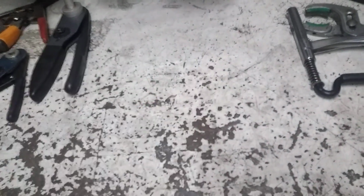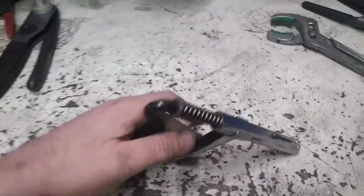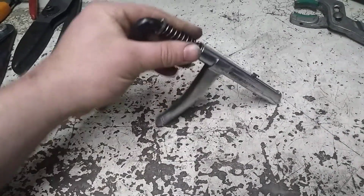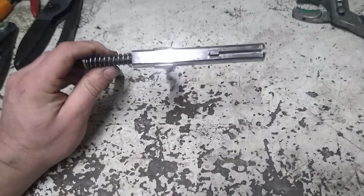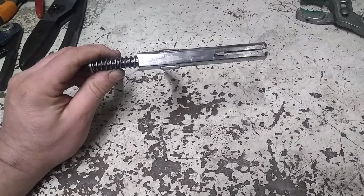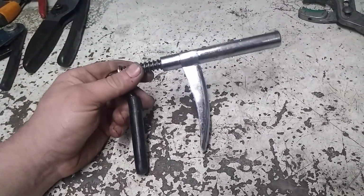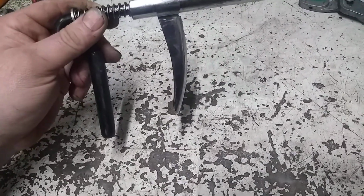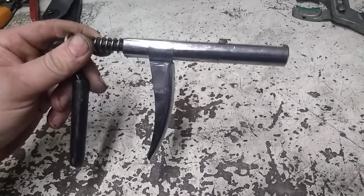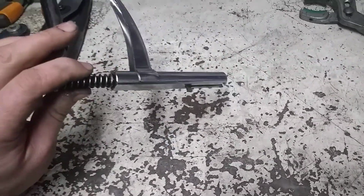They work excellent. And then a hack that one of the other guys at the shop taught me. This is actually a special tool, not for wiring, but for what they call shrink clamps. I don't know how common they are anymore in automotive, but instead of having a hose clamp, they're a frozen ring, and you stick them on there, and just getting up to ambient temperature causes them to contract and seal up the hose. And these are actually for cutting those off without damaging the hose, in theory. They don't work perfect every time, but they actually work pretty good on those butterfly style clamps also. There's not much of a ledge there. A little more bulky, but another good investment.